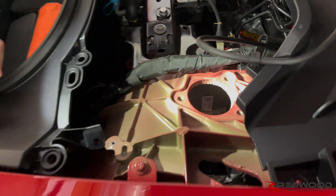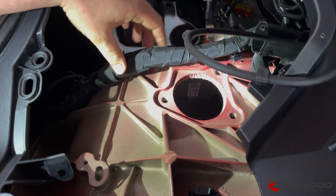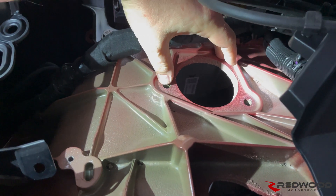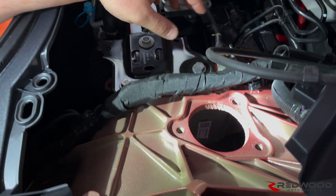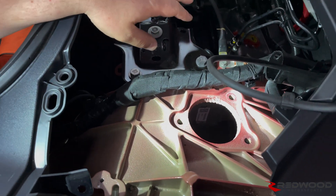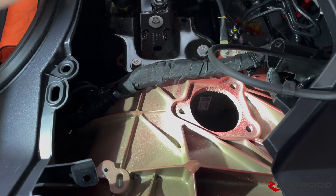Take a look up at the top to show you the upper side. You can see that the top of the shock bolts in right here directly through the main chassis. The older chassis had bolts for the carrier — one of them was about here — there were four bolts that held in that carrier, so it's a completely different style.